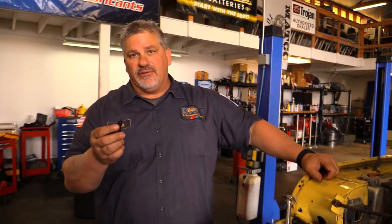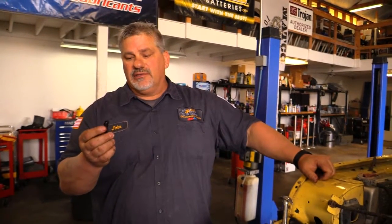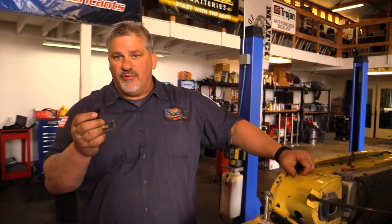So when you're getting your spark plugs changed, it's up to the mechanic to make sure that the car is sparked right, that the gap is right, and that the car is running at its optimum performance by making sure that it's not too black, you don't want it too light, and if you got a lot of buildup on it, white, it means it's running too hot. It means that somebody stuck in the wrong spark plugs. And so this one, in this case here, it's not running hot enough. That, and because there's unburnt fuel here, when we first poured it out, it was really wet. So that tells me that this carburetor is running way too rich.